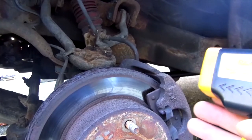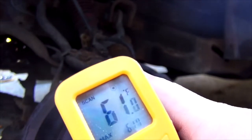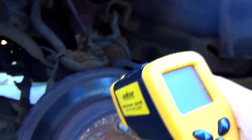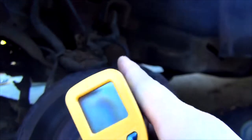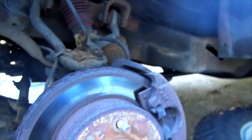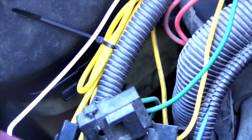What I did was carry the laser gun, and when I got to wherever I was going — because it was grinding a lot and every time I touched the brakes it would go away — I quickly jumped out and pointed this at the rotor through my tire to check the temperature, then ran to the other side to compare. If you have a constant-on caliper it should be obvious because you'll be pulling to one side. I used this same method to troubleshoot a friend's Audi.